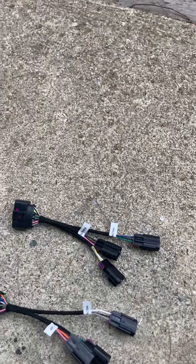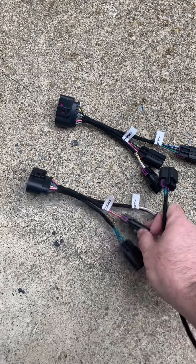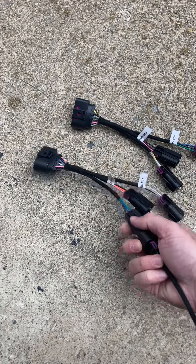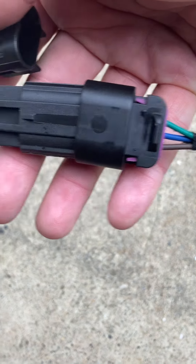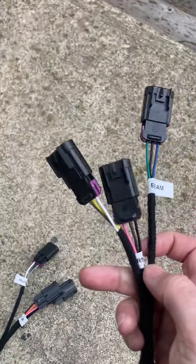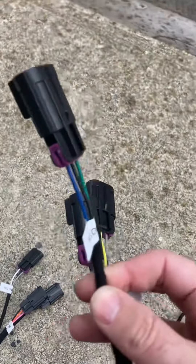You're going to pin each one into the correct position — they only go in one way and you'll hear it click when they go in. If you're inserting it and it's not working, just flip it and insert it and it should click. Insert all six, put everything back together, and close it up. There's a short run and a long run — the short run goes to your driver's side, the long run goes to your passenger's side. You're going to run one connector into each headlight location. When swapping the headlights you typically remove the grille, so run one across to each side. These connectors should match up perfectly with the individual headlight harnesses, and the wire coloring will match up too.